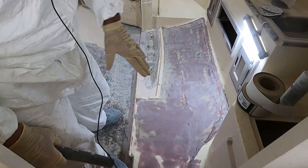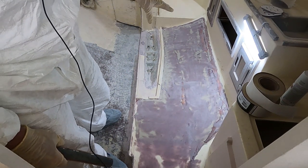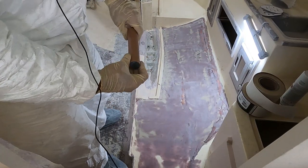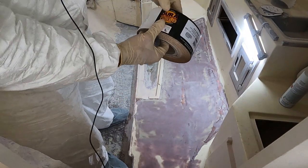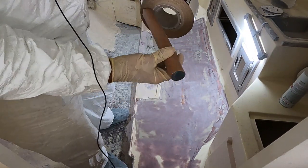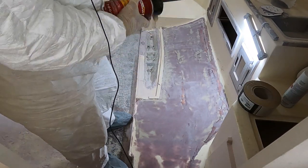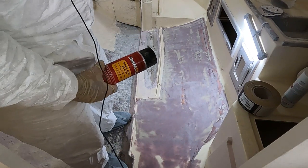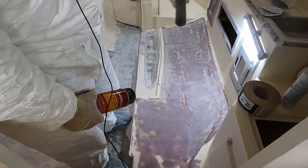So I've returned and sanded the second coat of fairing with the palm sander, and now I'm going to go over it with a round board and some roll of Duragold sandpaper. I'm using 220 here. What I'm going to do is spray some black guide coat over it, and then go over it with the round long board and see if I can find the highs and lows.